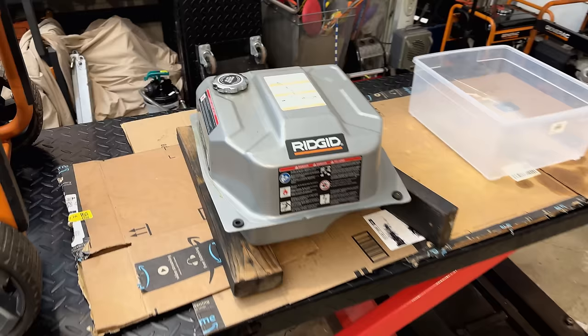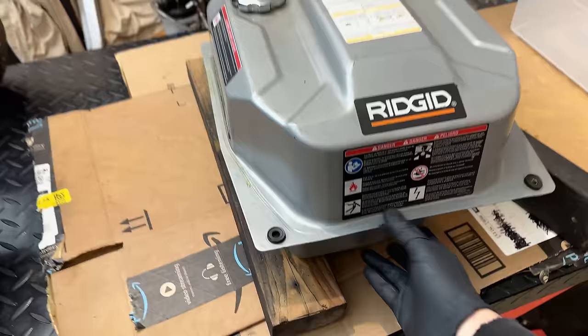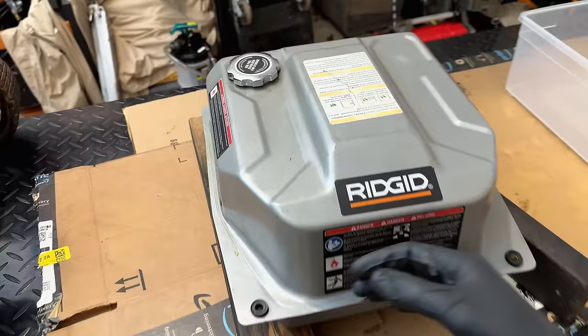I think it's time we get this evaporust out. It's actually been just under 3 weeks with the evaporust in there. I ended up adding an extra gallon because the two that were in there were turning pretty dark. And when that happens, it becomes less effective. So I gave it a good 2 or 3 days on each side, the rest of the time just cleaning up the bottom.